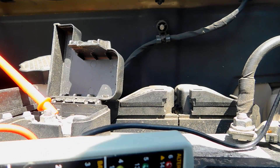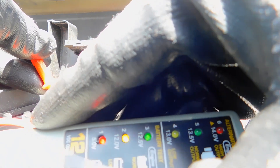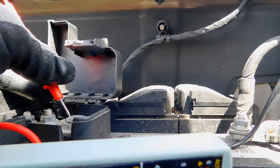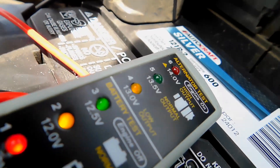I just cut that off. Now that the battery is charged, see — all three of them are high right after the battery gets charged, all three lights are lit. So a quick fix for now would be to change the battery. But as the alternator goes off, the battery power is back down to low. The alternator is overworking to charge the battery and keep it going. Alternator output is still low, but everything else is lit. I know I've got to get to my alternator very soon.